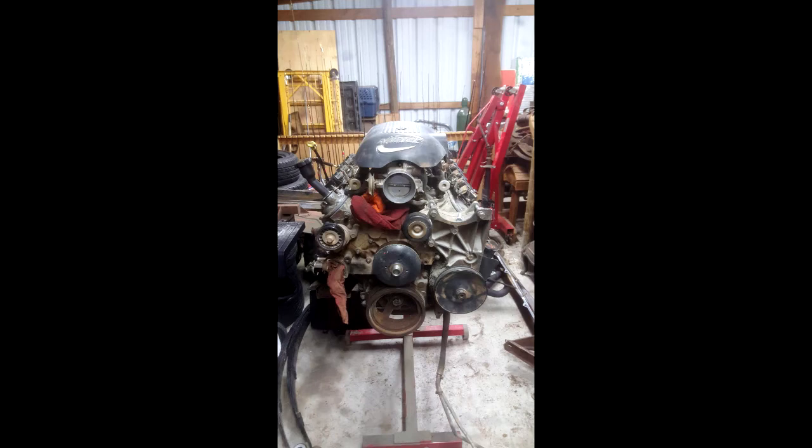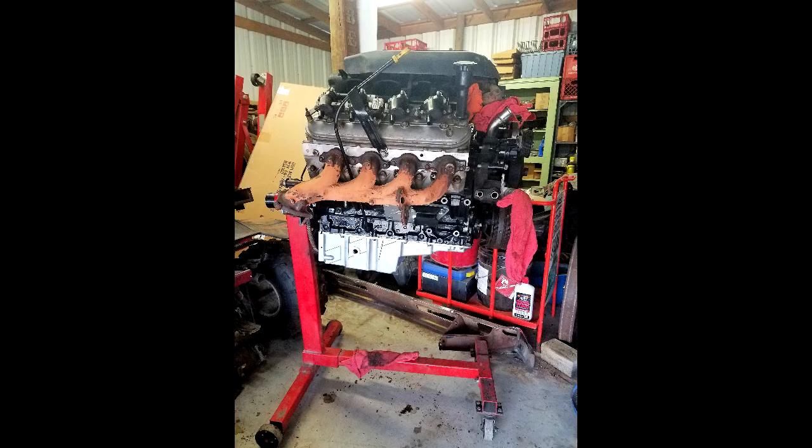They fit wonderful and have plenty of room. The truck pan will fit but it hangs way low, and since I put lowering springs it was going to be dragging the ground - the car sits pretty low. So what I did was buy an oil pan from Amazon along with the pickup tube out of an LS1 that came out of a Camaro or Trans Am. I put it on, put the thing in the car, and there's just a little bit of clearance issue for the steering.